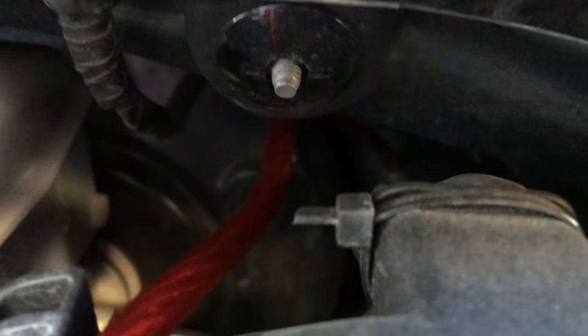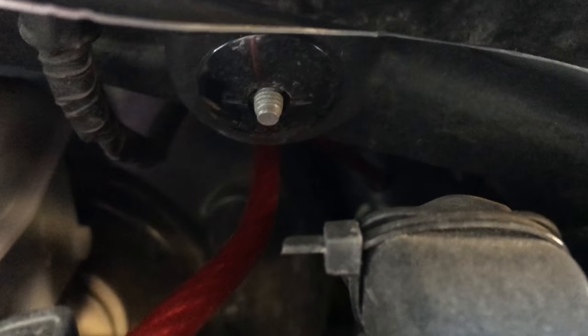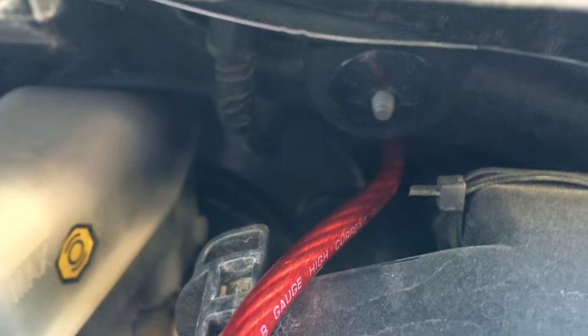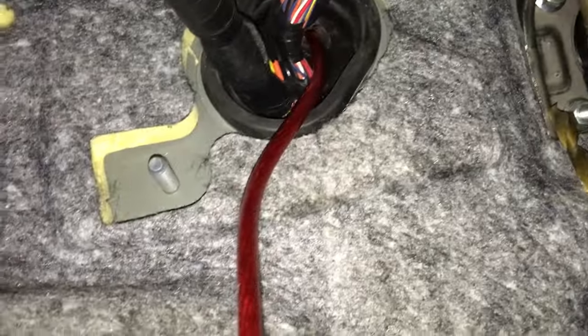Right there — as you can see, put a little hole back there. The easiest way: I drilled just a small hole on the other side in that grommet because it's housed with plastic besides rubber, and then I just poke this wire through. Just poked it right up through the grommet using this drill — it's still nice and snug so it does make a seal around the wire, so you shouldn't have any moisture issues.